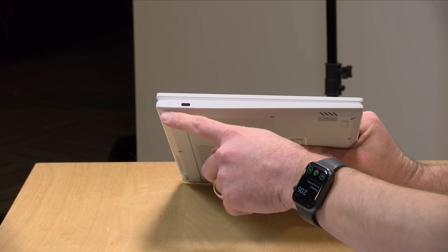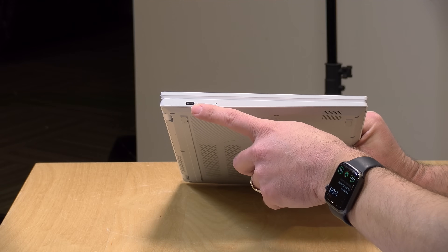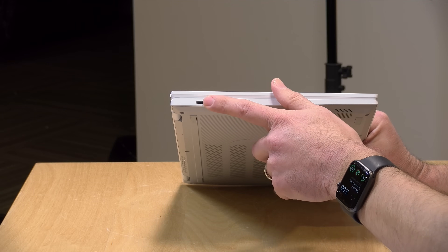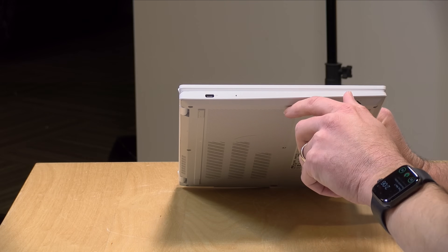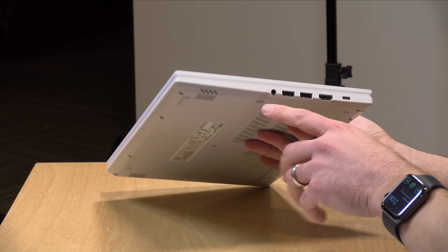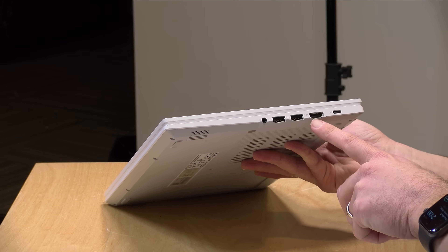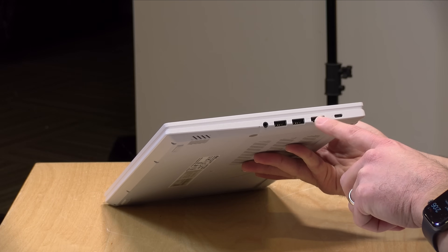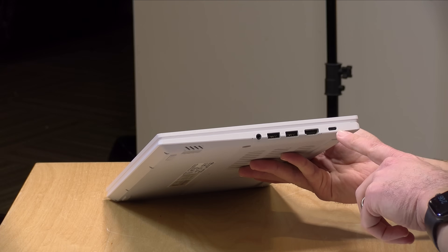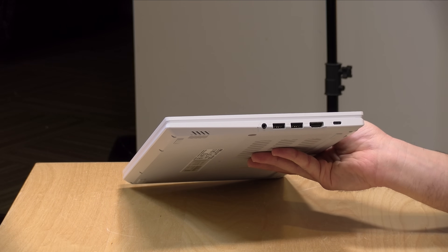As for ports, you've got a lot of them on this one. On the left-hand side, you've got a USB Type-C port — USB 3.2 Gen 1 — but it is full service, so it'll take power in, send display out, and do data devices back and forth. Gen 1 means this runs at 5 gigabits per second versus 10 that we typically see on higher-end units, but for a Chromebook it's perfectly fine, and you could use this with a docking station. On the other side, there are many more ports, including a headphone/microphone jack, two USB-A ports, and an HDMI output. This is HDMI 1.4, so it won't do 4K 60Hz, but you can hook up a display adapter to the USB Type-C port for a better output option. The USB-C port on this side is configured identically to the other one — you can plug power into either side and get video out of either side as well.